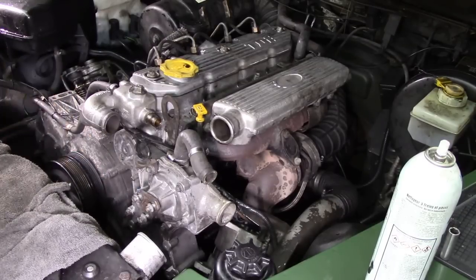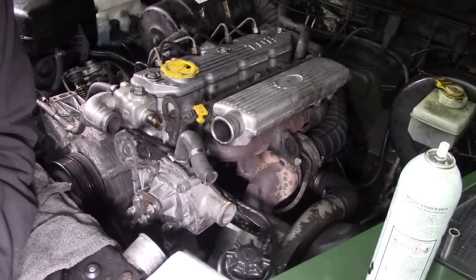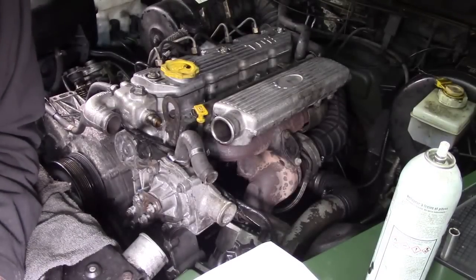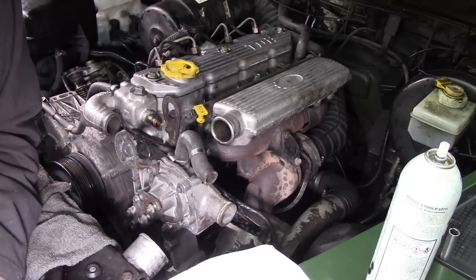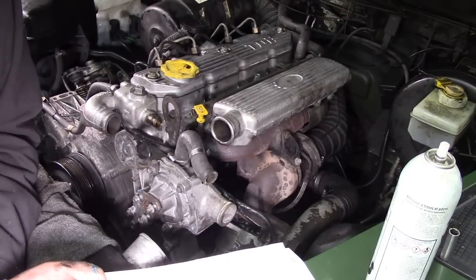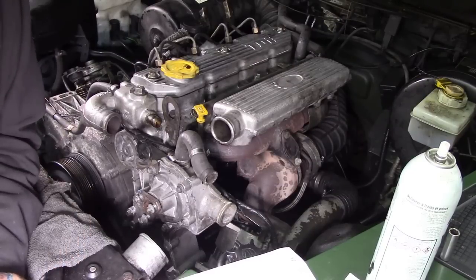This nut here was 45, I do believe. I brought the paper out, look. Printed it out. Here's one thing, I'll tell you, I printed this out of the workshop manual. There exists a book, the 300 TDI Rebuild Manual. It's absolute rubbish. Most of it's missing. So I went on a Disco 1 workshop manual and looked at it, and lo and behold, there it is. Tensioner timing belt is 45. Yeah, water pump to mounting bracket, water pulley, and the pulley bolts are 25 Newton meters too. It seems to be that all 8mm threads are 25 Newton meters, so that's kind of easy to work out.